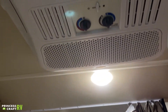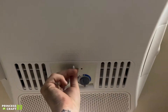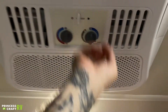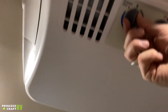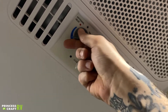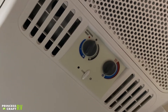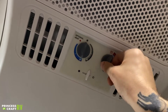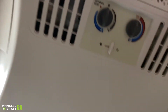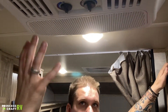Then we have your air conditioner. You can really directionalize where you push that air conditioning — it has louvers on each side and a main vent that pushes air straight down. Looking at this display, your indicator is going to be towards the front as the starting position. We have three fan speeds: low, medium, and high — those are for conditioned air. If we go to the other side, that's just fan mode. There's a thermostat to choose your level of cool. Very straightforward and very customizable. You can also add an optional heat strip if you'd like an electric heat option.